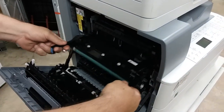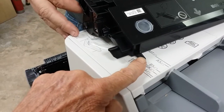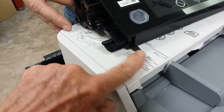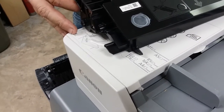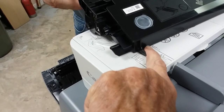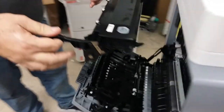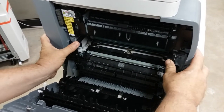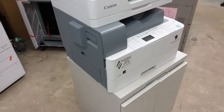We're going to pull the drum unit out and set it up here from the top of the machine. What we have seen is there's a tab right here — this drum unit gets pulled out sometimes and put in crooked, and it will bend this tab over to the side. When it does that, you will have blank copies. If it's bent over to the side, try to take your finger and carefully reform it back straight, then put it straight back into the machine and give that a try. We've seen this a lot, so see if that won't fix the problem for blank copies on the 1435.